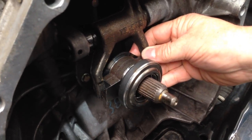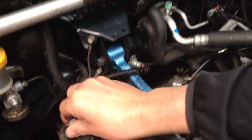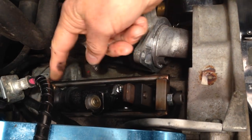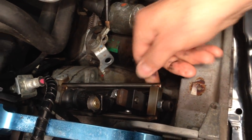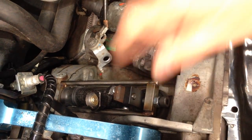The release bearing is here, so when you put your foot on the clutch it slides in, and when you take your foot off it slides back. Up the top here is the original pull-type slave cylinder, which we're going to bolt onto the new replacement slave cylinder and the adapter assembly to convert it from a pull-type to a push-type assembly. This part here is adjustable and looks a little unusual, but when it's all mechanically together it's very, very reliable.